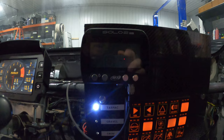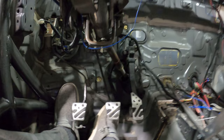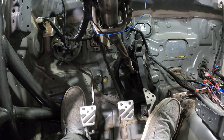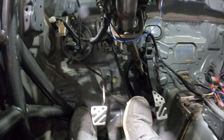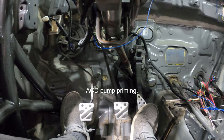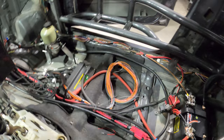For data logging and lap times I'm using an AiM Solo 2 — the cheapest option since I already had one. It just wires into the CAN port on the Nexus. I also added an Evo 10 pedal, which is a drive-by-wire pedal, along with an Audi R8 drive-by-wire throttle body. This allows me to run auto blip on downshifts and full throttle shifts. There's a switch on the brake and on the clutch — when the ECU sees the brake pushed and then the clutch pushed, it gives a little blip of throttle so I don't have to heel-toe. For full throttle shifts, if the gas is all the way down and the clutch is pushed, it gives an ignition cut.